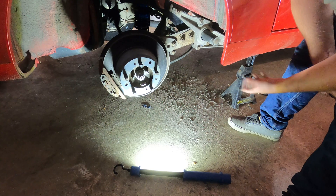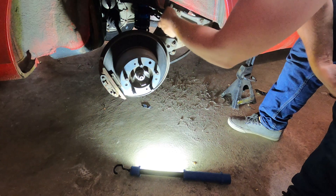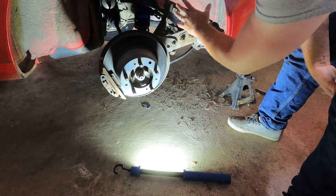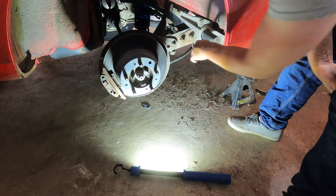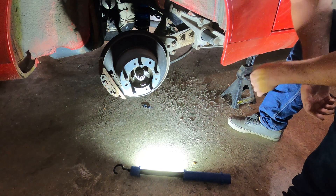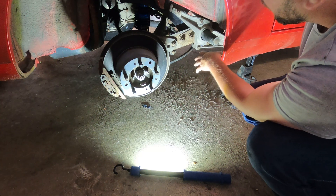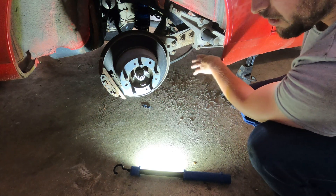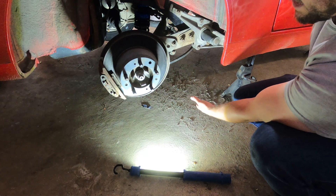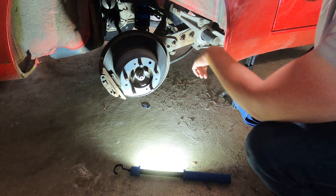How it really all works: I had to take everything out to delete this, so that's what I recommend you do. Start where I started — with the sway bar. Make sure you hang the axles and hang the rear trailing arm because you don't want that stuff to fall or move. Then you can basically unbolt everything else. Once you have everything marked as to where it sits, start pulling the bolts out — you can see I have them labeled. I needed a pretty big pry bar. You put a jack under the center of the housing for the torsion bars and start pulling down on each side, going side to side until you get it. Bring it down, take these end caps out — you need all these bolts out to pull this entire piece off to get behind it, get the end caps out, and pull your torsion bars out.